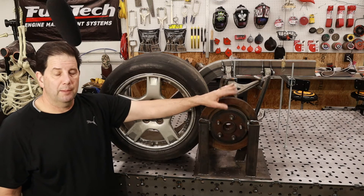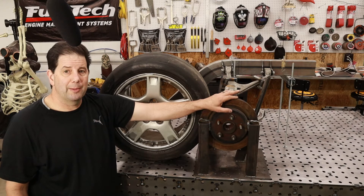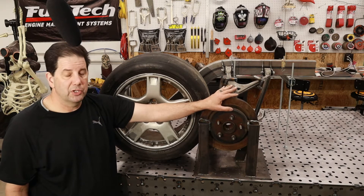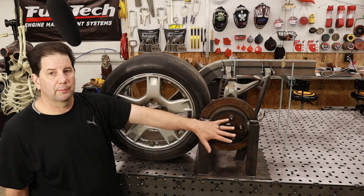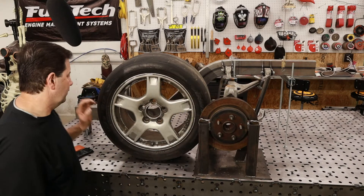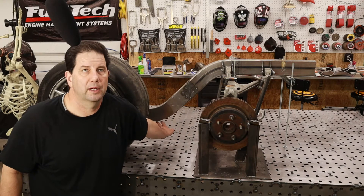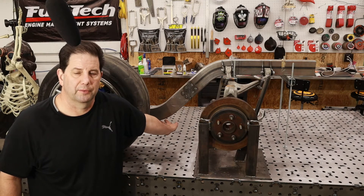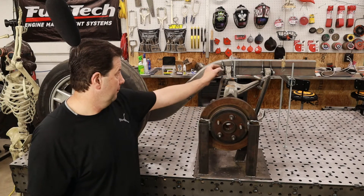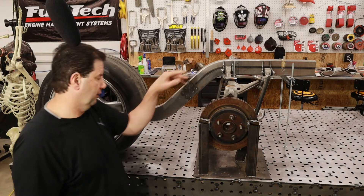You could say, why don't you just raise it up and go with a little bit different angles there? Well, the fact is I'm not a great suspension geometry expert. GM has spent a lot of time and money creating the suspension geometry, and I don't want to actually change it before I even get the car built. I may end up lowering it or changing it slightly, but my goal really is to have this at the factory ride height. This is actually only four and a half inches off the ground versus Corvette's six inches off the ground, so basically if I raise this up, this whole frame rail we created is garbage.